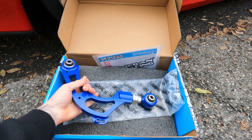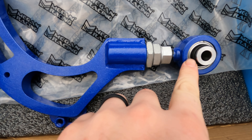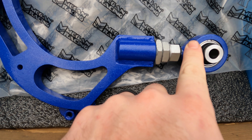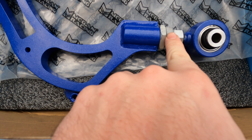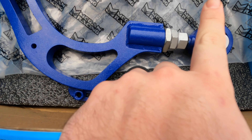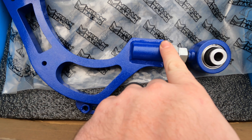Here's how it works: you slap them on and you have three adjusters — one, two, three. Two of them are your locking jam nuts, and the inner one is just to turn the inner spline. You turn it to whatever degree you want, then lock this in and lock this in. When locked, it can't turn at all while driving — very good.